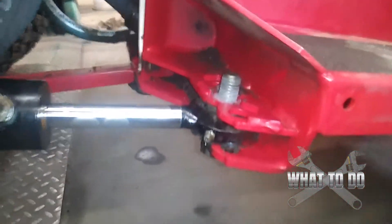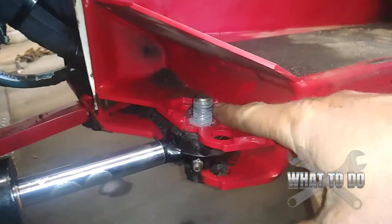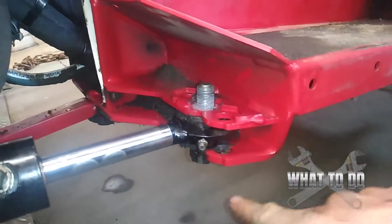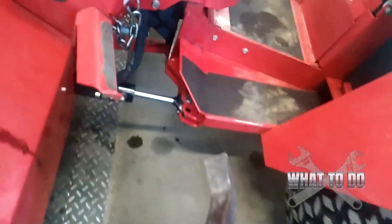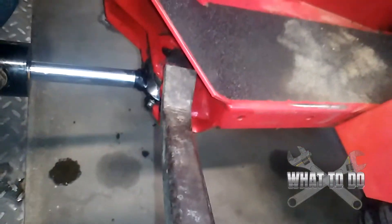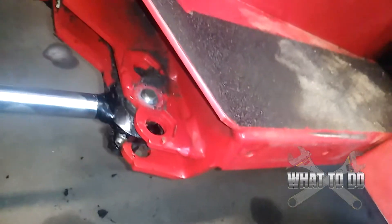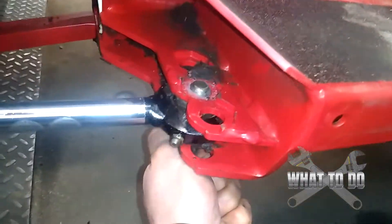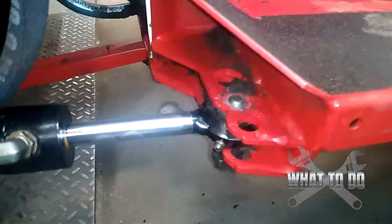I already took that nut off, and what I'm going to do now — this is really tight here. Without destroying these threads, I'm going to get a little pry bar and try to pry this out, but I can only do this with one hand. I took the bar, it had a little lip, and I stuck it in there and banged down on that bolt and got it almost out. If I can't fit my bar in there, I'll get a punch, put it down on an angle, and tap that bolt out the rest of the way.